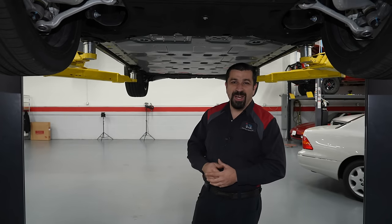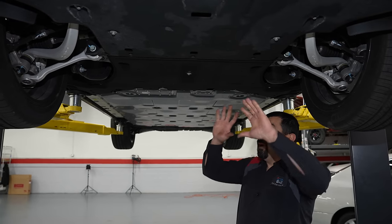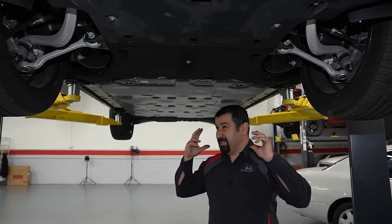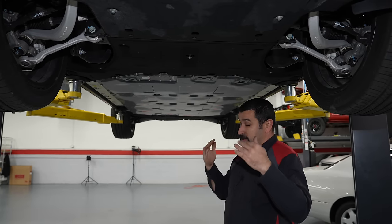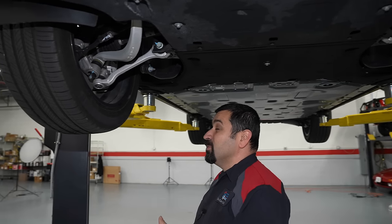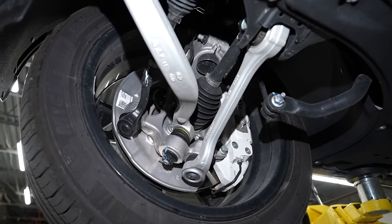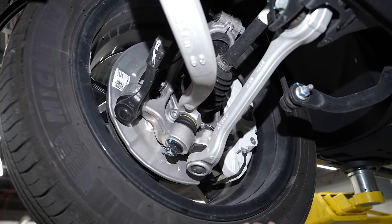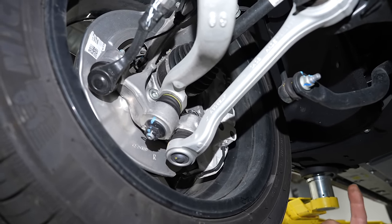Let's take a look underneath the GV70 electrified version. Everything is covered and flat — this is an electric car, and having looked under the non-electric version, things are similarly covered. Looking at the front suspension, it's interesting: the bottom half is typical luxury car — two control arms, everything in aluminum, two ball joints, nothing out of the ordinary for a luxury car.